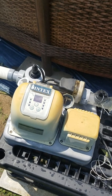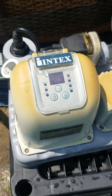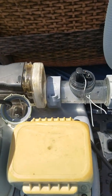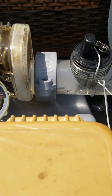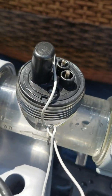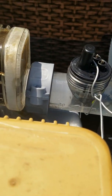I've replaced the pool and got the salt water generator out. Just about 30 seconds after the working light would come on, I would get a beeping alarm, low flow light, and code 90. I checked for proper visible operation — this is a little magnetic flapper switch right here. I made sure there were no bubbles in the system, because a large bubble will often accumulate around the switch and won't allow it to actuate properly.